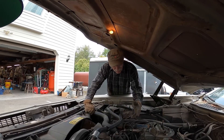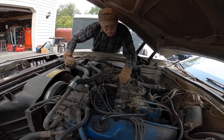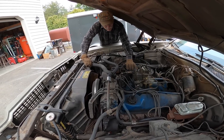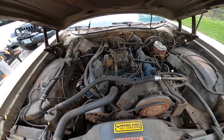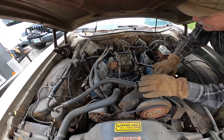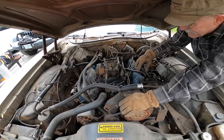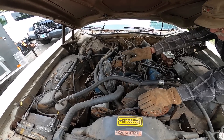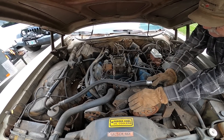You can tell which is number one cylinder because on a V8 one valve cover sits further ahead than the other. This would be number one on this side. It's kind of like looking at a tree — people think all the leaves are the same but if you look close they're not. On the other bank that would be number five, six, seven, eight — and one, two, three, four on this side.